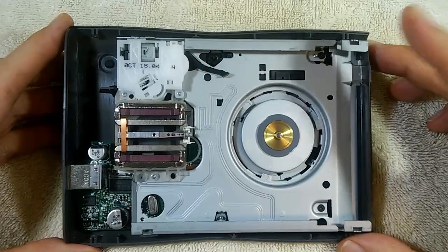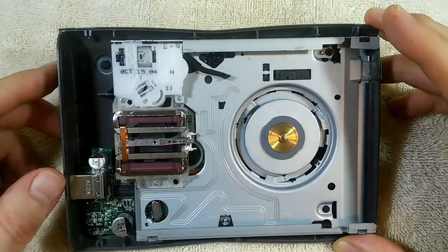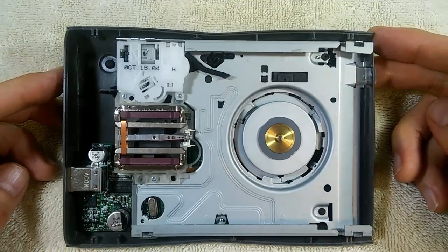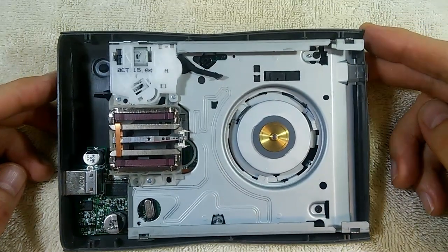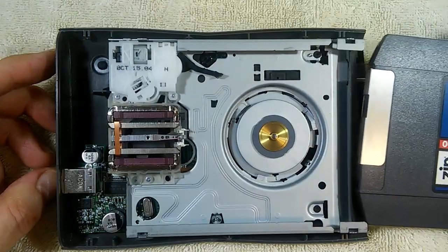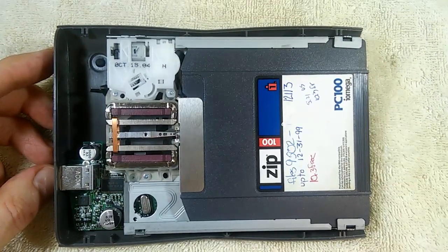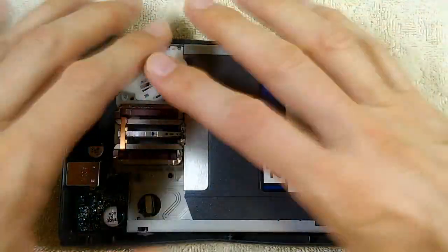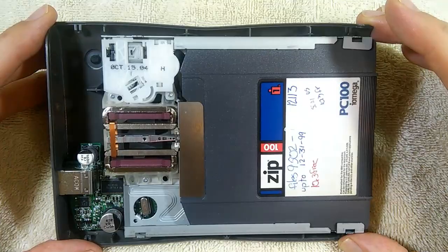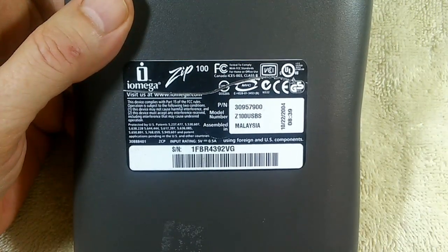Sadly, I have spent quite a bit of time troubleshooting this thing and I cannot isolate the failure. It is sort of intermittent — when I press on different areas I get different symptoms. So there's probably a bad connection or solder joint somewhere. This drive also suffered from the infamous 'click of death' issue, which nearly ended the company. Taking it apart, I have to say I'm not really very impressed with the quality of the manufacturing. It's not surprising it failed — it's more surprising that it lasted as long as it did. So if you happen to have this model, the Z100USBS, and you have a stuck disk, hopefully you have learned how to eject the disk from this video.